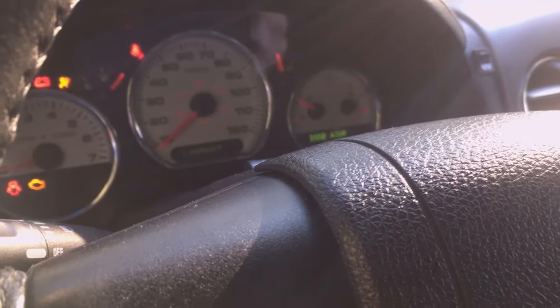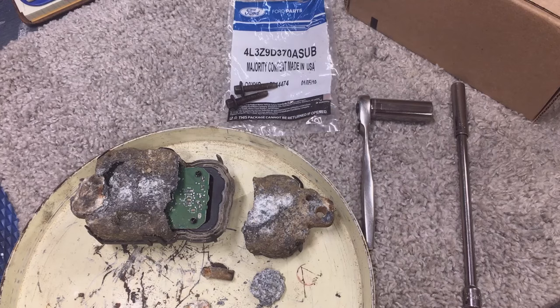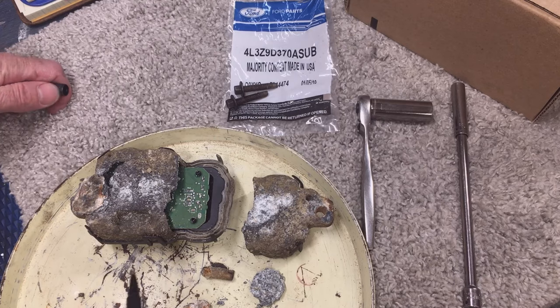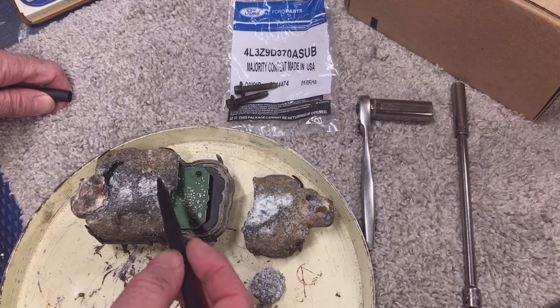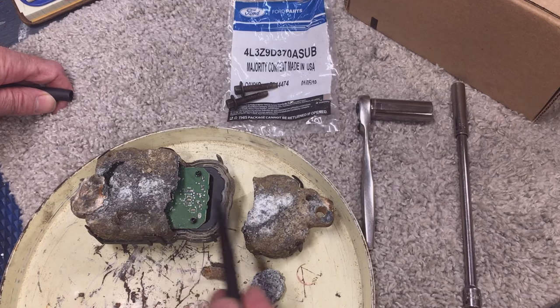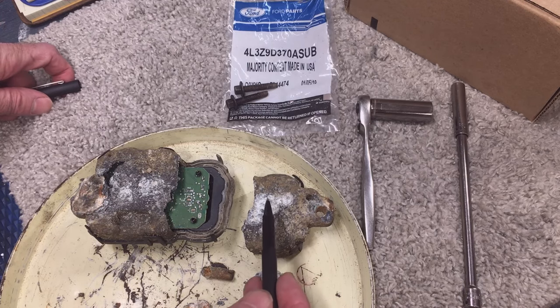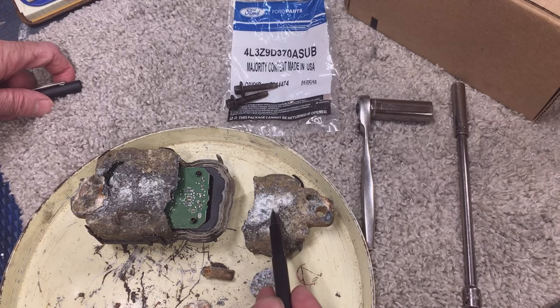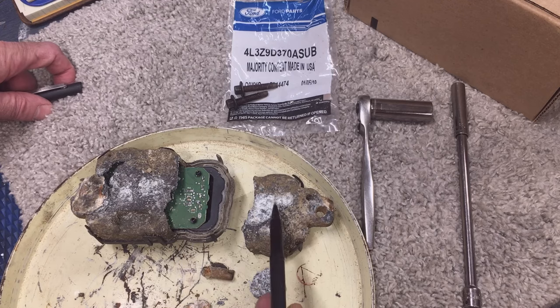Let's try the key — I heard the fuel pump turn over. That takes care of my cranks-but-fails-to-start condition on my 2004 to 2008 F-150. The 5.4 liter, along with all 2004 to 2008 F-150s, has a regulatorless fuel system that is electronically controlled by this fuel pump driver module. If you haven't changed out this module and you live in the northern states where they use salt on the roads — or a salt brine in summer and heavy salting in winter — I'd recommend changing it out, because it's probably corroded. My truck has 202,000 miles on it.